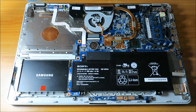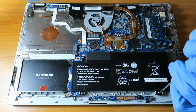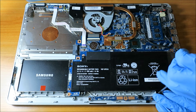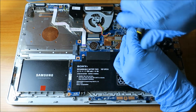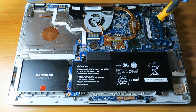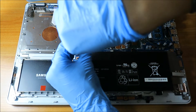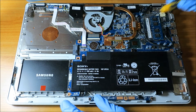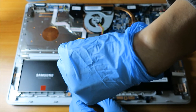Here's my RAM. 8GB is fine — I've got 8GB of DDR3L RAM. In this day and age, it's now 2019, you really need 8GB of RAM. I checked the manufacturer website, the old Sony VAIO website — and you guys should do that too, always check your manufacturer website. It said something really weird: 8GB, with 4GB on board. That means 4GB is welded in underneath, combined inside the motherboard, and the other 4GB is a stick. After some searching, the Crucial website said it can be upgraded to 12GB total — so 4GB on board plus 8GB I'm going to add now.